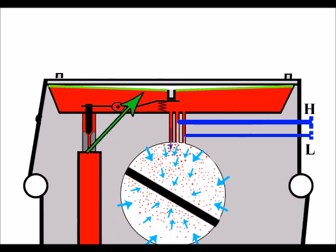So again, it's another one of those scenarios where the diaphragm itself is in good order and it's working correctly, and the spacing between the diaphragm and the back of the lever is correct, and everything else is fine, but because that spring's not correct, we're getting the problems we're getting.